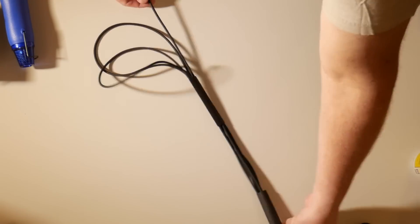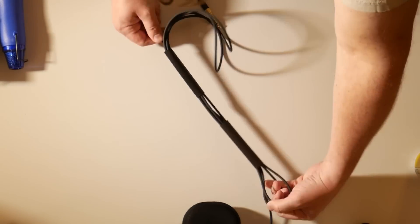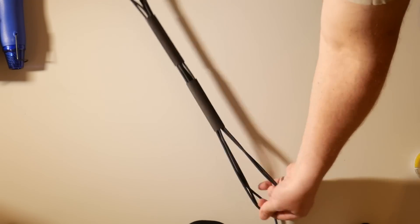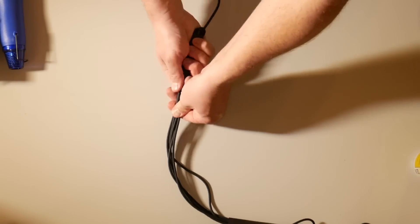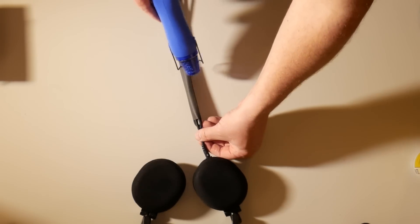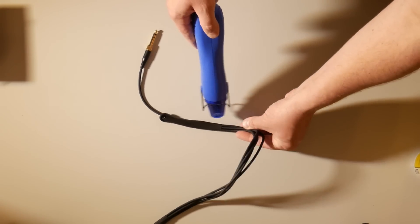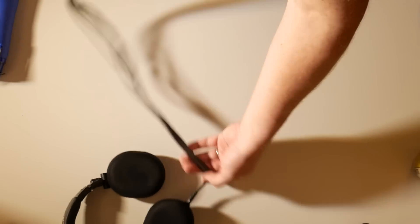Another thing you need to know is not to buy heat shrink with adhesives on the inside of the tube, unless you want to make the mod permanent. It's important to size the heat shrink correctly to the cable, keeping in mind how many times you plan on taking the cable back and forth. In this example, I'm wanting to reduce this 10-foot straight cable down to just over 2 feet long, so I loop the cable back and forth until I have five cables going between the two pieces of heat shrink. It's a bit of a tight fit, and that's a good thing. Once I have the loops neatly overlaid, I bring out my heat gun and go to town. The finished cable will feel heavier, and all that extra weight will be hanging from your headphones, which can put extra strain where the cable attaches, so be aware of that, especially if the cable doesn't have built-in strain relief at the connector.